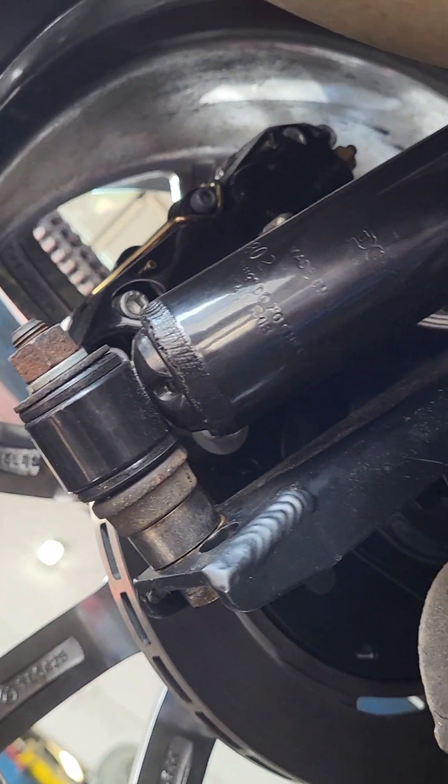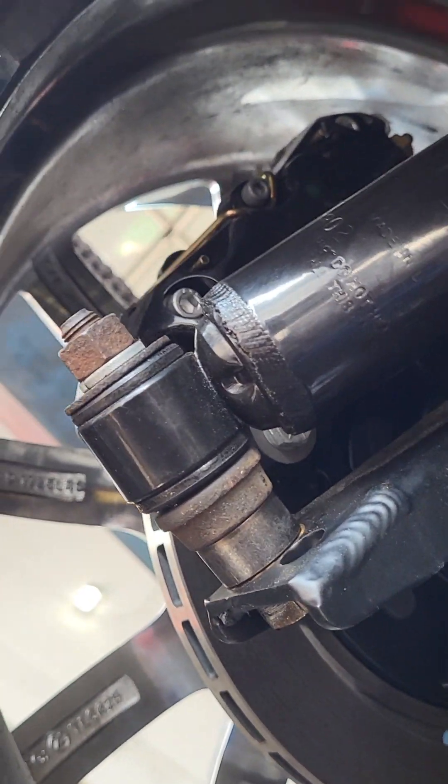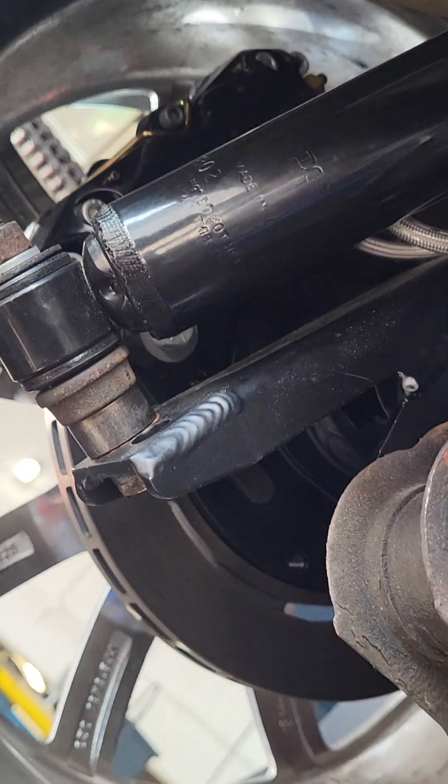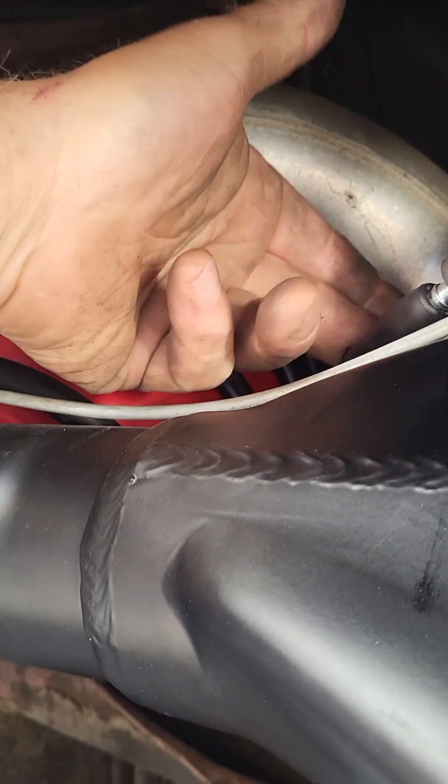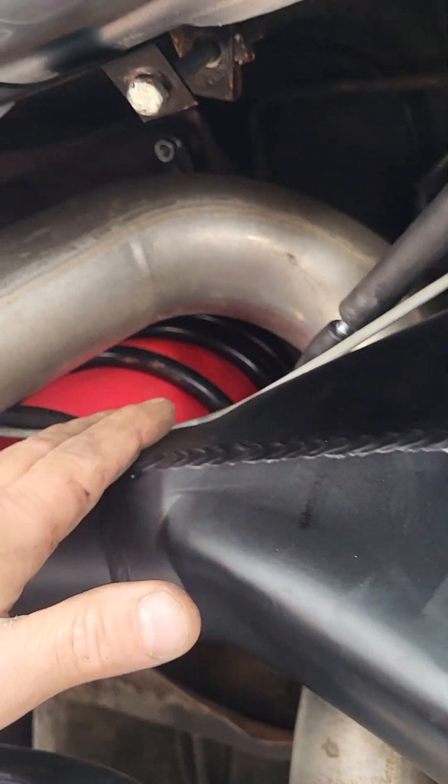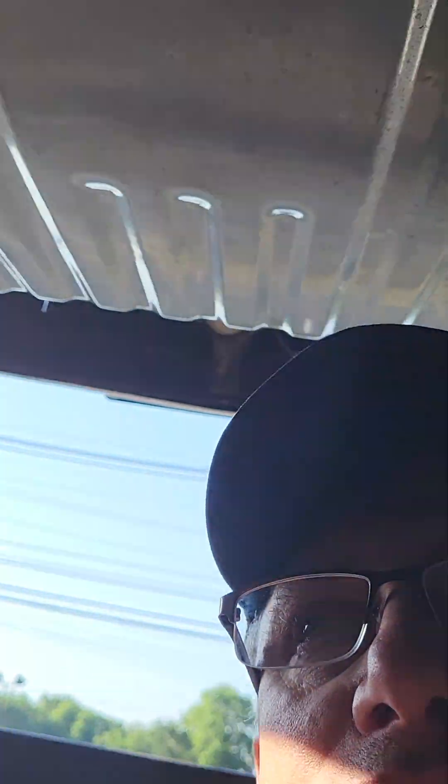I'm okay with this, I'm just not thrilled because I don't have enough materials here to make this work the right way. It should be okay — worst case the shock will loosen up over time. Once I got all my clearances set with the suspension all the way low, I raised it up, put 20 pounds of air in the airbags, and gained two inches of clearance up in here, which certainly helps. Let me finish up this brake line clearance and then we're going to ship this car. Thanks for watching.